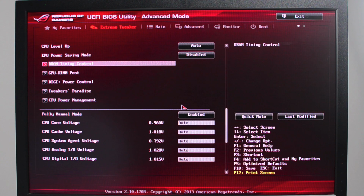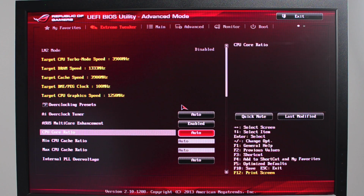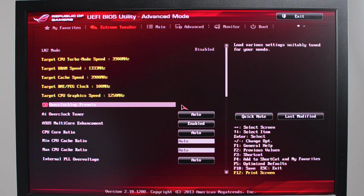So yeah, because I've had crashes in the UEFI or BIOS setups, and it's not until I actually hit the keyboard that I realize that the system's locked. Correct. And so this is just an immediate way for you to reference whether or not the system's still working. Has anyone given you feedback that they want that pulse more frequent? Because I feel like I have to wait that extra half a second to know whether or not the system's hung. Yeah, I suppose that'll be an interesting point of feedback that we'll get from users on whether or not they want to be able to tweak it. For the guys that are interested, you can go ahead and disable this if you don't want to have it turned on.